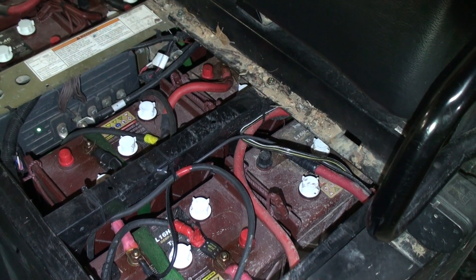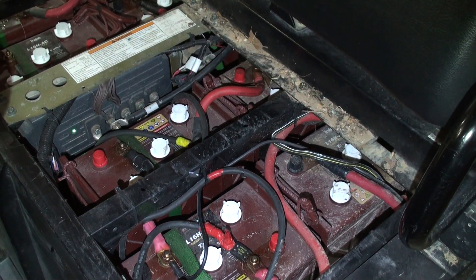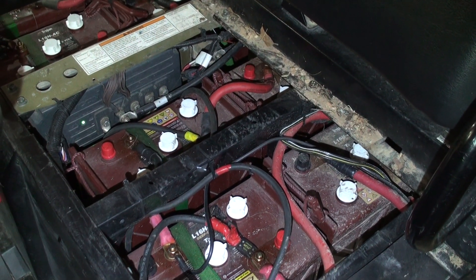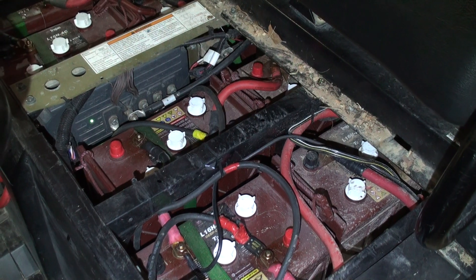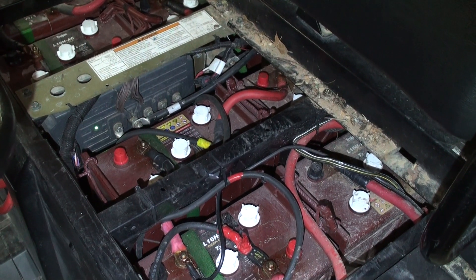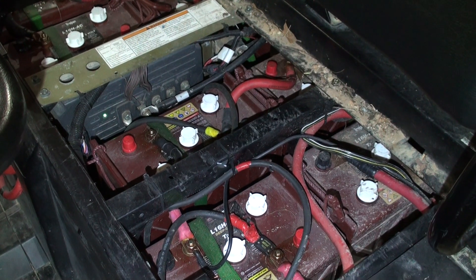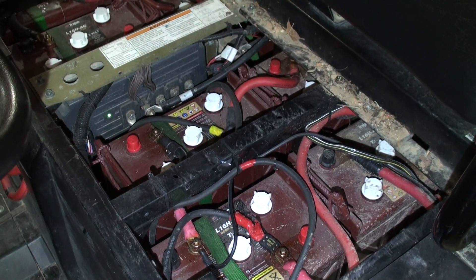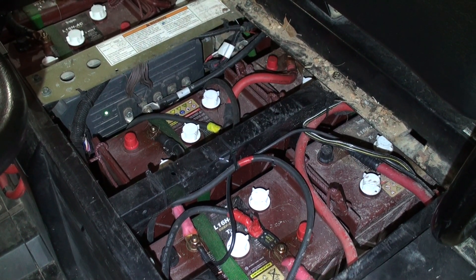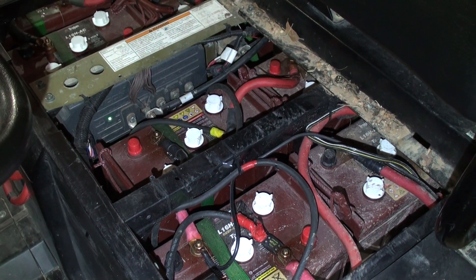That's what makes the motor stumble. When you first take off, that's where your maximum amperage pull is — that first second when you hit the throttle and start accelerating it really draws down the amps. Also, when you're going slow you use a lot more amps, which is really the way I use it. Once you're moving along the amp draw goes down considerably, and once you're moving it doesn't seem to have any problem at all.